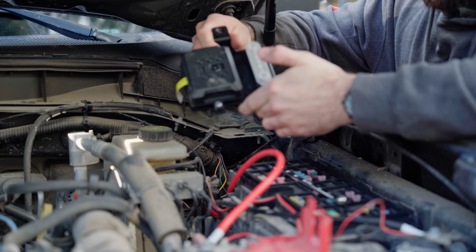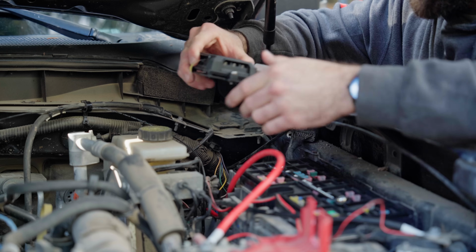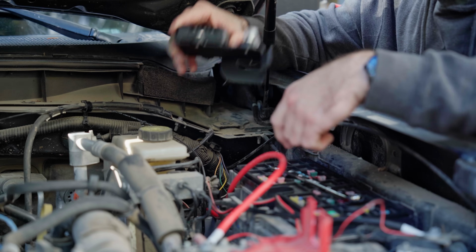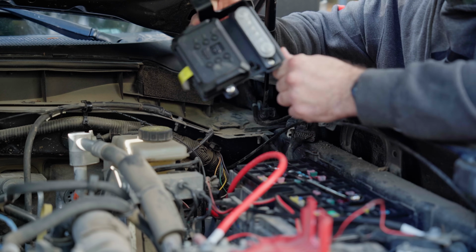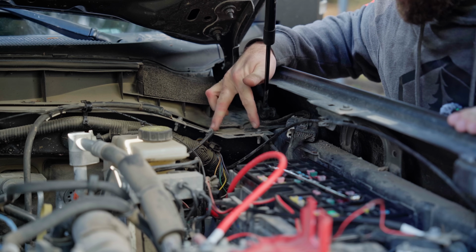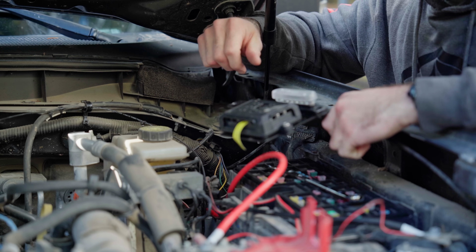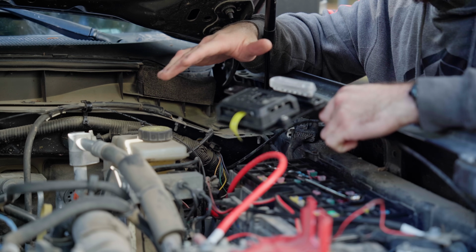So Blaze makes their own mounting kit for the Garmin power switch. It's really, really nice. There's a 13mm bolt that sits behind the fuse panel, which is slotted, so you can just loosen it a little bit and slide this right into place. And then on the other side, this is threaded, and you can see this big cutout right here in between two of the small grounds on the firewall. This will sit below that and then thread the provided bolt into it, and that's all there is to mounting the power switch.